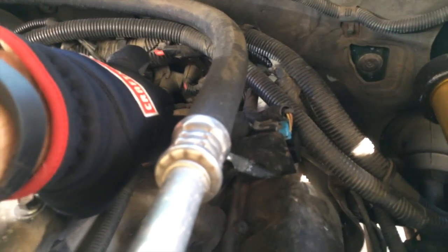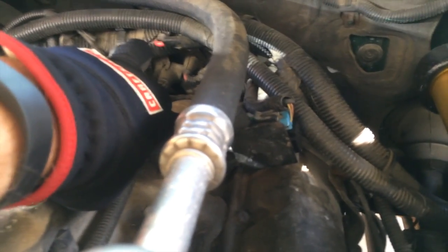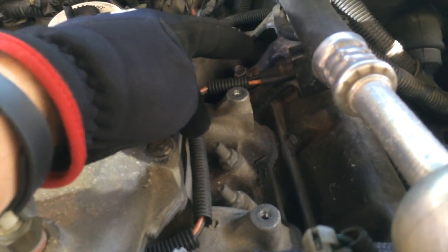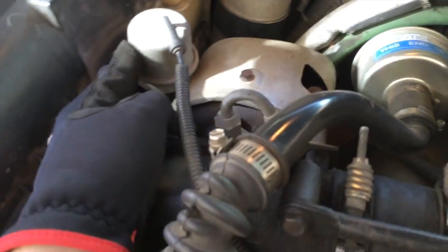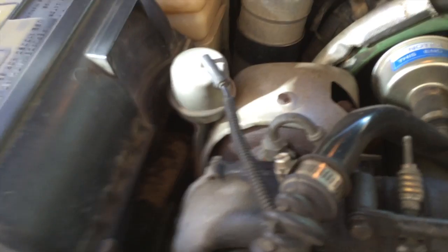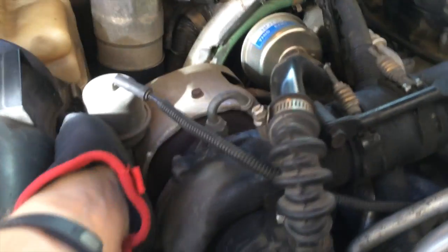This is an electrically operated solenoid valve, operated from the powertrain control module. When it sends out a signal to need more boost, it lets the vacuum from this pump flow into a second line — a hard black plastic line — that comes back through the same wire loom. That line routes over to this can over here, which is a vacuum actuator. Inside this actuator is a diaphragm that's pulled up by vacuum and a spring.